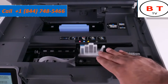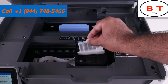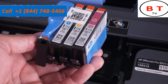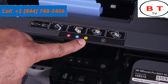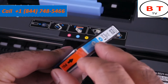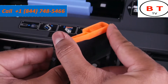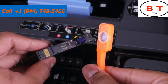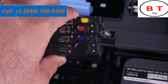As soon as you open that last compartment, the cartridge tray slides into view so you can easily work on it. First, remove the piece of plastic inside the cartridge tray and trash it — it's just a protective piece. The printer comes with four cartridges: a set of tri-color cartridges and a larger black cartridge. There are corresponding markings on the tray indicating where to install each one. These cartridges need a little prep before installing: pull the pull tab until the plastic covering comes off, then swing the plastic ink covers outward — it's a lever that swings out and pops off. Do this for all four cartridges.